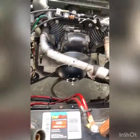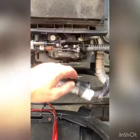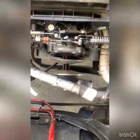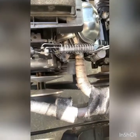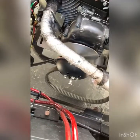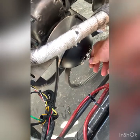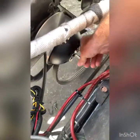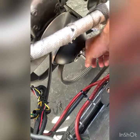Real quick before I run to the hardware store to get a bolt — it slid right on. I don't have to change out the keyway. I'll have to do a slight motor adjustment and kick the motor to the driver's side just a little bit so the belt wears evenly, because this clutch isn't as thick — it now sits closer to the engine. I don't want the belt to wear, especially after I just bought a new $70 belt. The shaft sits about an inch longer — it doesn't need to go in that far. I need to get a different bolt and a bigger washer — probably a grade 8 washer on the outside and maybe a grade 5 bolt, because if it breaks I won't be able to drill it out.